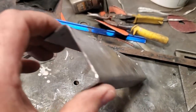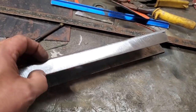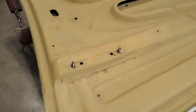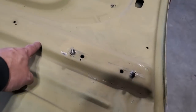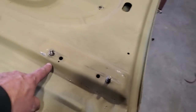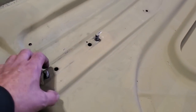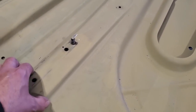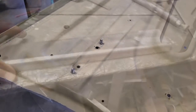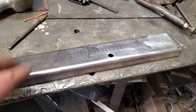I got them bent at a 90 degree angle - they're not going to stay at 90 because I'm going to roll them back, but I need to figure out how wide I want them. This one comes down about three quarters of an inch here and this side is only about a quarter of an inch. So I'm going to cut off both ends to the width I like - that way I know I can start working it to fit down over this here. I got both sides trimmed off, so now I'm going to start dialing it and fit it in place.